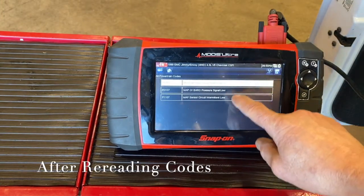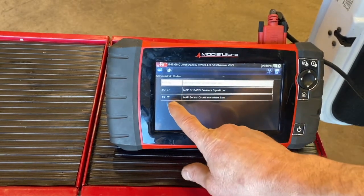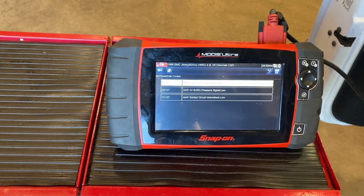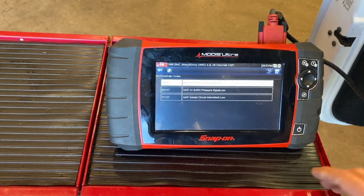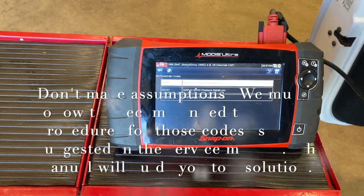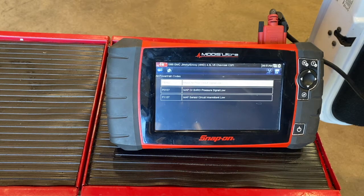We're going to go back and re-scan. Right away, as soon as a fault was set, it automatically picked up an issue with the MAP sensor — P107 MAP barometric signal showing up. Our MAP sensor combines a MAP and baro sensor in one, which is why we're showing two signals. So right away we can see what area of the car has problems. It's a MAP airflow sensor issue and also a MAP/baro sensor issue. Both make sense. Now this doesn't completely solve your problem — it tells you where to go on the car, and then you look up the procedures in the manual.